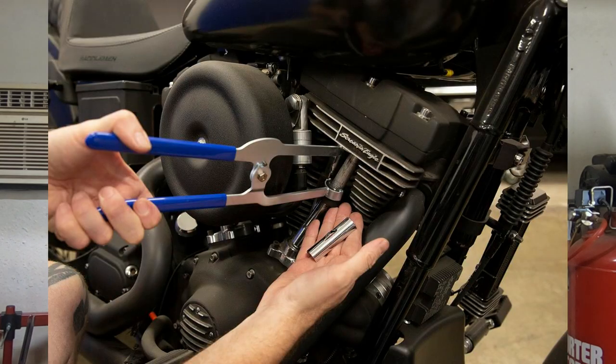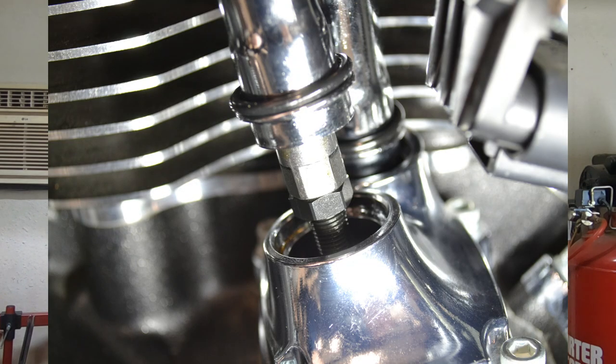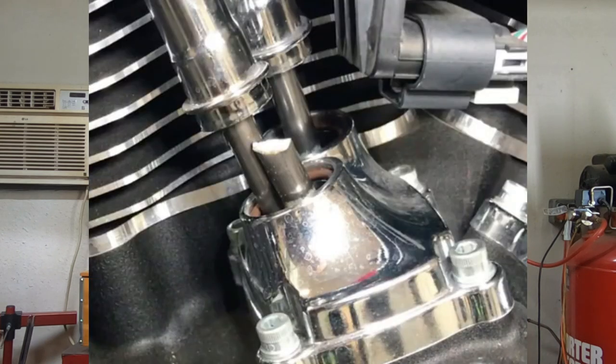Now when it comes to your push rods, this is really a judgment call. There's really nothing wrong with adjustable push rods. I personally kind of prefer solid push rods because there's not a jam nut in there to back off. But on the other side of that, you've got to know exactly what length you need with the cam that you put in the bike. If you went with anything other than a bolt-in cam, things get a little complicated — you can't just make length out of a solid push rod. But solid push rods, being solid, are going to be theoretically stronger than an adjustable push rod.